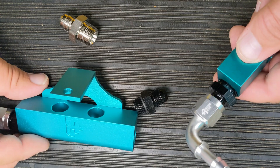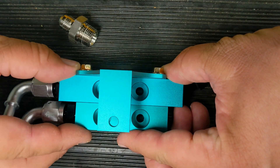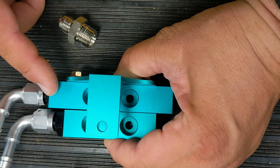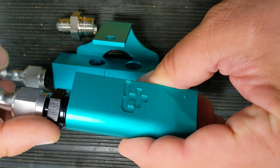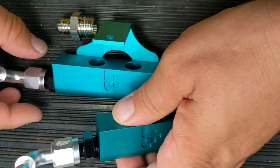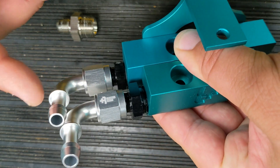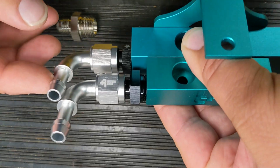That change also allowed us to change the distance of the rail. When you're looking at where the injectors line up, the rails themselves are a little bit longer. The NPT fitting doesn't actually go all the way in when you're getting a seal, but the port fitting does go all the way in. This allows the rail to be a little bit longer to meet up and also gives slightly more distance out here, which helps clear the wires.